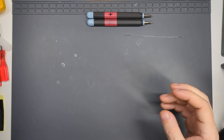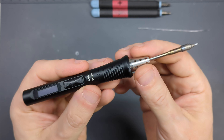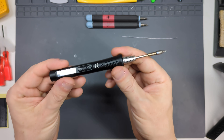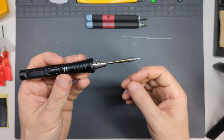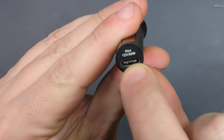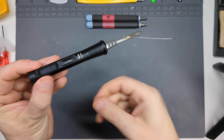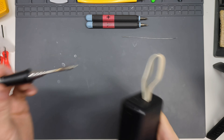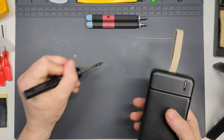In terms of equipment, I am currently using this MiniWare TS80P soldering iron. It was quite expensive and it's only because I do a lot of soldering that I invested in this — I certainly wouldn't say something like this is essential for a beginner. This is powered by USB-C. There is a little socket on the back; you need a 12-volt, 30-watt input, and then you can just solder. I find this really handy out in my shed because I can just get a USB cable and plug it into my USB battery pack.